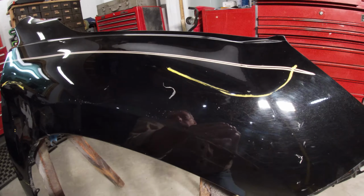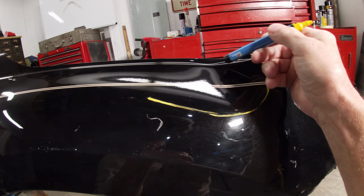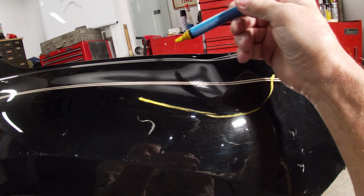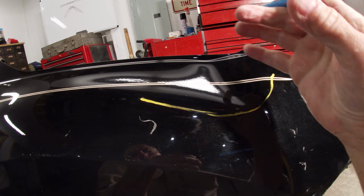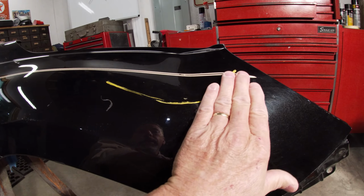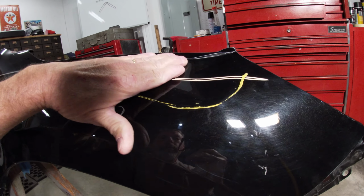So you have to work on them both kind of at the same time. Usually what you'll do, you'll come in here and you'll get most of this dent out, maybe 60% of it. You'll get it bumped up, roughed out. Then you have to come in here and relieve the stress in this thing. And with your dolly behind it, you'll hammer this down. You can't get this high spot out of it unless you have this dent mostly removed.